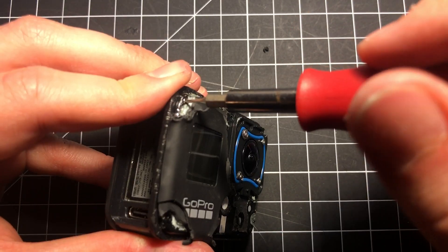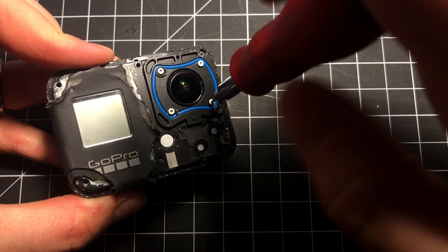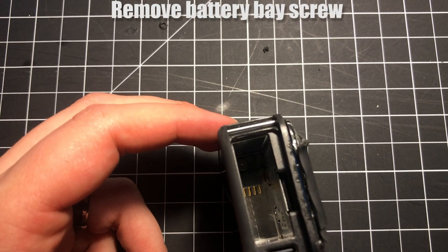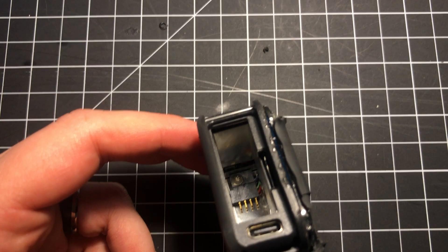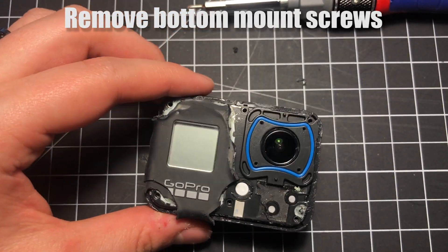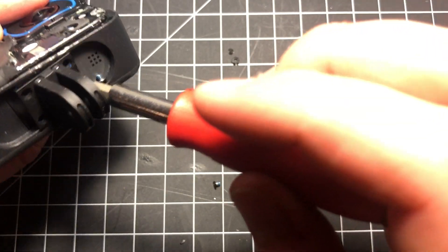As for what you do with these screws, if you're using the iFlight kit, don't worry about it — you can just get rid of them because we're not using these screws. Anything you need is all in the kit to put that case together. Next we're going to go into the battery bay area, and down in there is a small Phillips head screw. Get out your Phillips head screwdriver, one that's long enough to go down in there, unscrew it and take it out — it should be a snap. There are just four more Torx screws to remove before you can start to pull the front assembly off of the LCD panel.